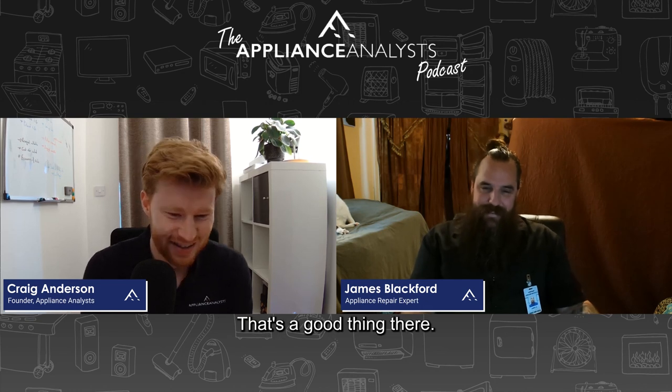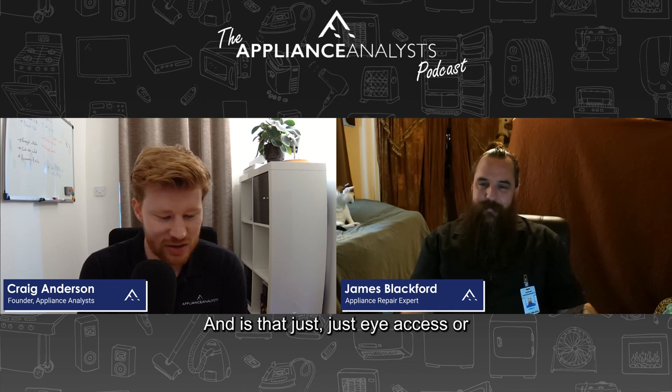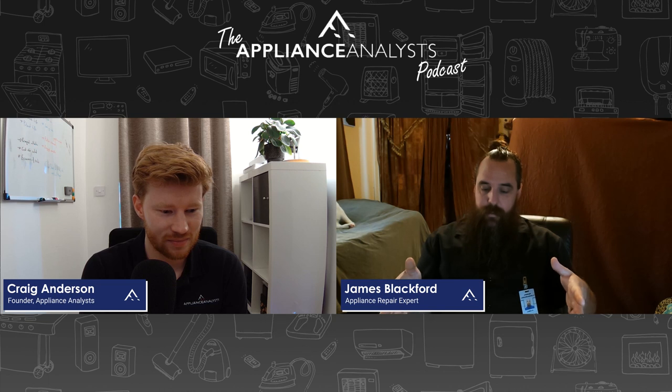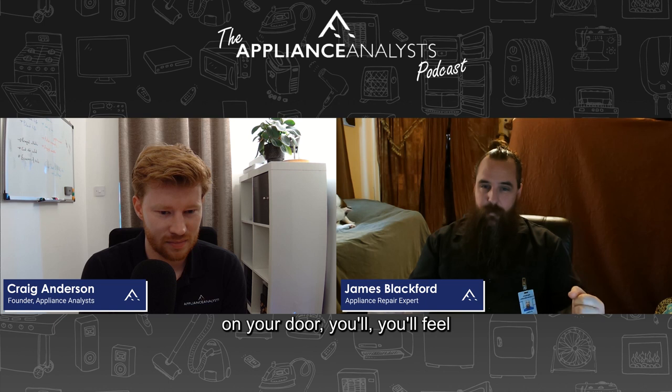Okay, yeah. So try not to stand on your dishwasher door and you should be good. Yeah, that's a good thing there. Because sometimes changing those hinges is kind of a pain too. Okay, and is that just access, or can it get really fiddly? The way to access the hinges on some of them is kind of difficult, because you need to remove the door panel and the control panel. And the way that the hinges mount, they're pretty thick metal. There are these little metal tabs that keep the door and the hinge assembly mounted to the frame of the dishwasher.